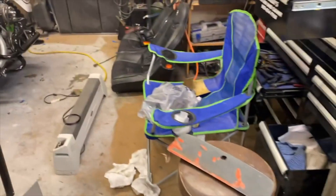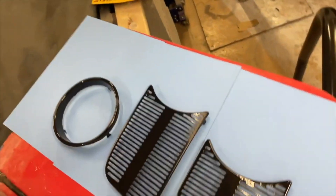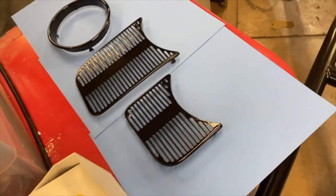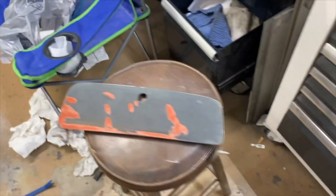Where there's a deep scratch I'm using some spot putty, going to sand it down, get a primer, and get it painted black. Got all the dash pieces done - went ahead and painted the surround around the speedometer black. The speedometer is cleaning up good, just waiting for the ring to dry. Got it sitting on a heater to get some heat into it. Anyway guys, that's it for this video - thanks for watching, please subscribe, hit the like button, and go work on your old Volkswagen!